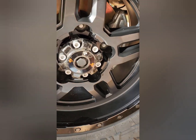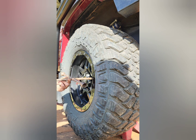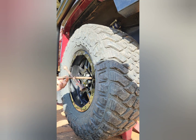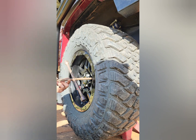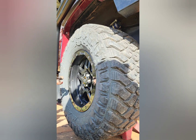I should note there's a common misconception that the centre part of the hub takes all the weight — it actually doesn't, as demonstrated here where I can actually move the wheel up and down. So let's have a look at this in real time. I put my wheel on, do the checks, and start doing them up finger tight. Notice I've jiggled the wheel around a little bit just to get them to seat properly.